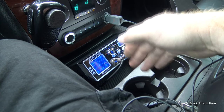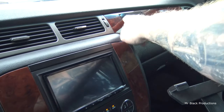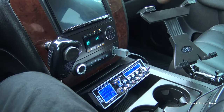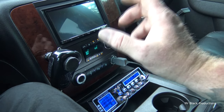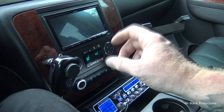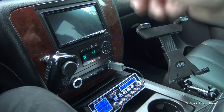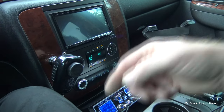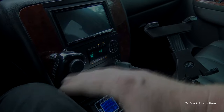bonded it to the LP100 box itself down in here. And then the opening for the meter, I blocked off with a piece of phenolic and bonded it shut. Then I took the LP itself and, with a 2-inch wide piece of ground braid, went down to the frame. I took a clamp-on type 61 ferrite that had a 3/4 inch opening, so a fairly large round piece. I made the cable so I had a lot of extra length, like an extra 1.5 to 2 feet. And I took that clamp-on ferrite and wrapped the data cable through it 2 or 3 times. Killed all the problems. All of the problems.